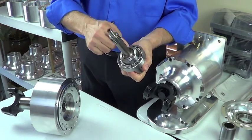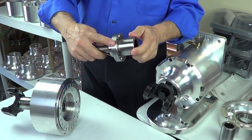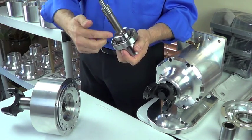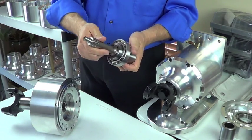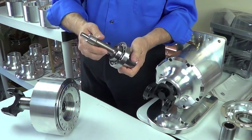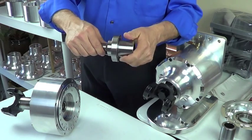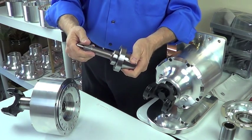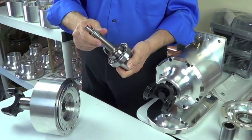On the coupler, we have retained with a spiral lock ring a steel roller bearing. The housing is steel. The balls themselves are ceramic for our EV units — they're steel in our non-EV units. But because of the high RPM on the input side on EVs, 12,000 to 13,000 RPM on some of them, we use a ceramic ball for that ultra-high speed.